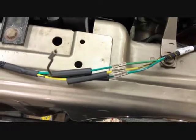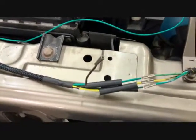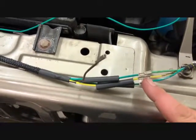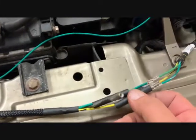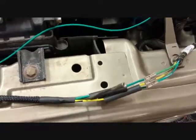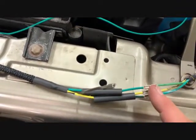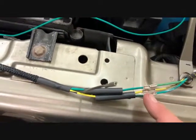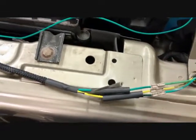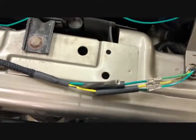You can make fun of me or call me unprofessional, but I can tell you that I never solder wires — never. I use uninsulated butt splices and then cover them with dual wall adhesive-lined heat shrink, and that seals all the connections. It also provides strain relief at the joint. If I was to solder these together, a lot of times solder makes the wires brittle and it's very time consuming. I just don't see the added benefit, because if you look over this vehicle with a fine-tooth comb you will not find one soldered joint on any of the wiring — so why should I solder it?